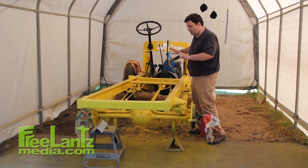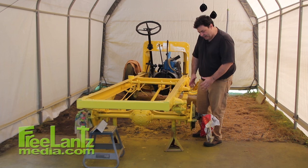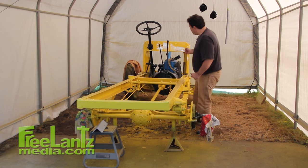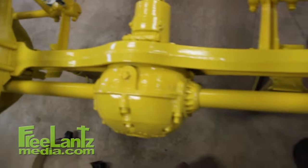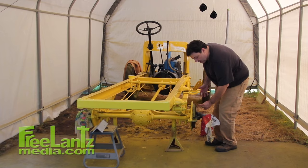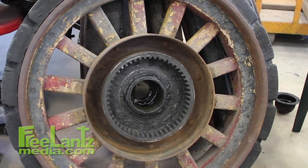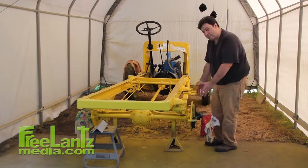This is a 1914 Republic — it's not done, but before it got put together I wanted to show the way they got the necessary gear reduction to use it as a truck. It's still one-to-one out for its top gear, one-to-one at the differential. For their huge reduction, instead of a chain they ran a spur gear and then an outside gear on the drum which drove the tires. The axle is still an old-school trailer-style axle, just floating by itself, and the hub — the brake drum — is driving the tire.